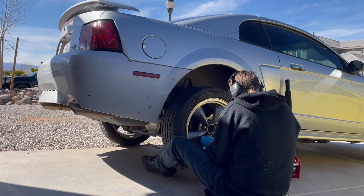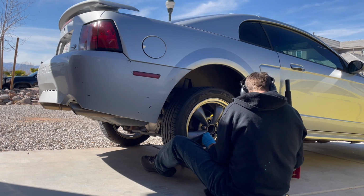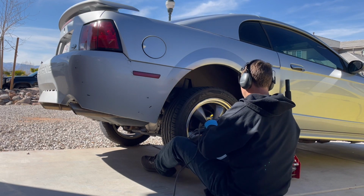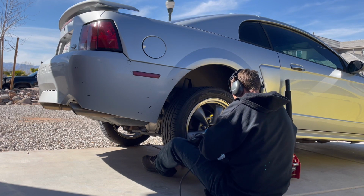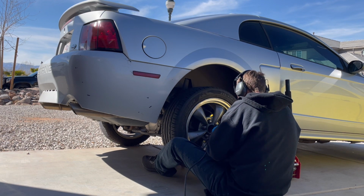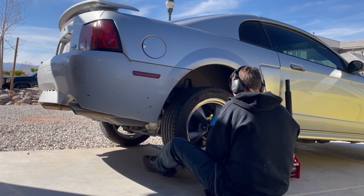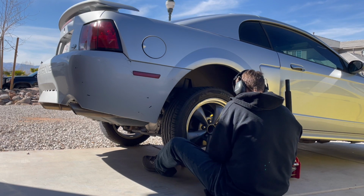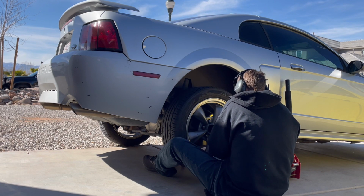I've done it before where I take the licorice patch thing. It's basically a nice kit that has two T-handle tools, and one of them has a spiral drill bit looking metal barb on it that you go in and out of the hole where the screw or the nail was, and it cleans up the tire. The other T-handle has a little point at the end where you stick in the licorice piece. It's a really sticky, gummy patch, and it looks like a strip of black licorice.